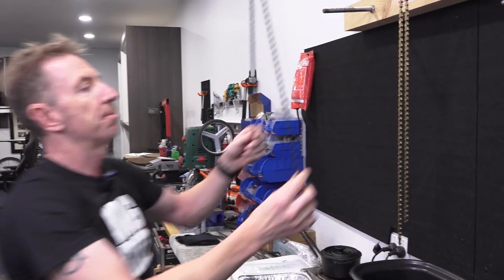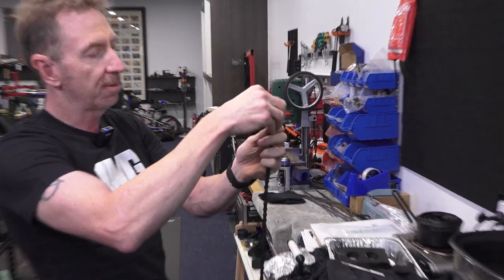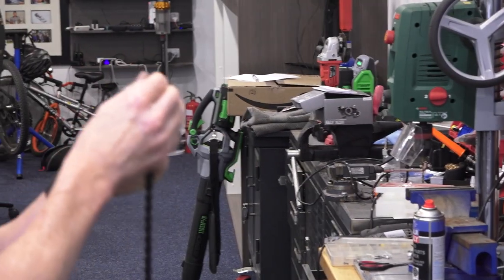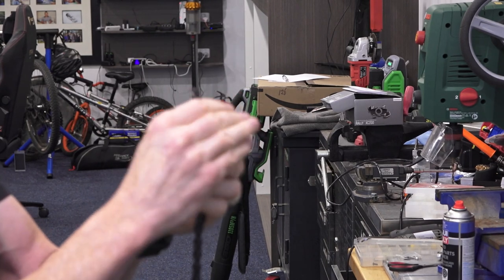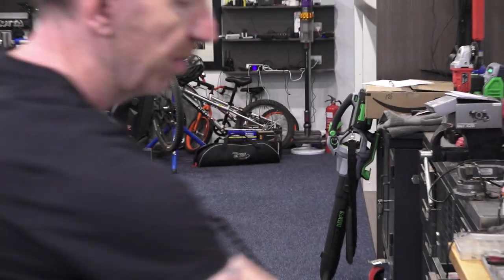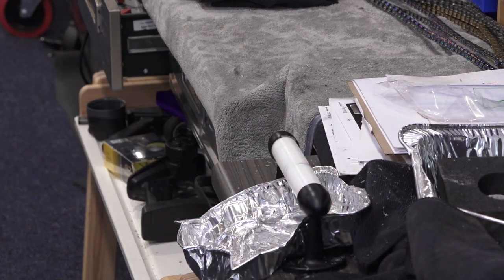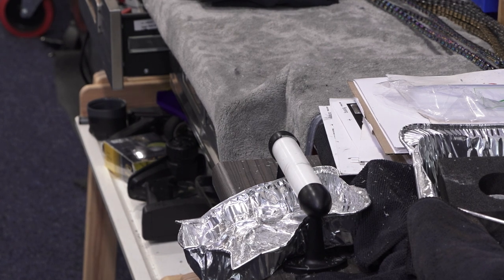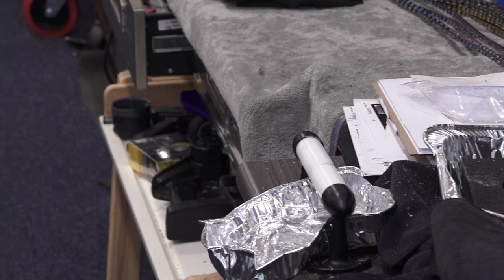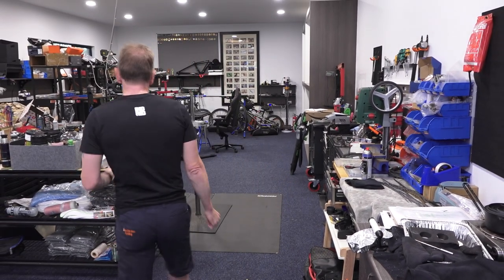Here's what I've done earlier for demonstration purposes. A freshly waxed chain is stiff — you do need to break the wax link bond before you can reinstall it onto your drivetrain. You can do it link by link with your thumb, or set up something where you can just rip it through, like a piece of dowel or a wheelie bin handle around a tool stand. Once that's done, you're ready to reinstall it onto your bike.